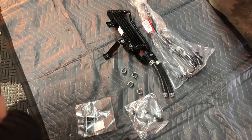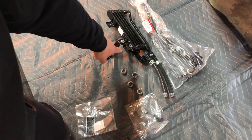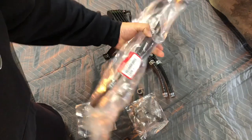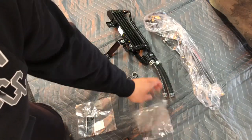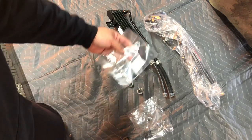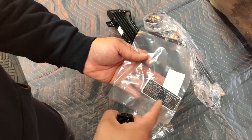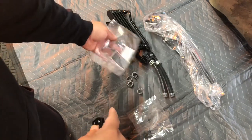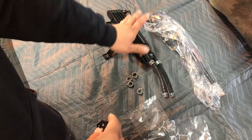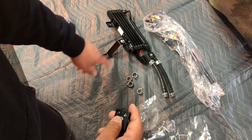Let's take a look at the parts. What we have here is the trans cooler itself with some extension hoses as well as hoses, four clamps, four bolts, and the all-important sticker that's gonna go on your replacement trim piece in the back that gives you a 5,000 pound rating for your vehicle. If you don't do this conversion, Honda will void your warranty on anything related to transmission issues if you tow over 3,500 pounds.